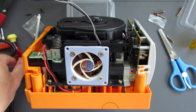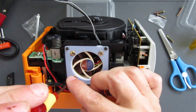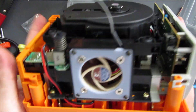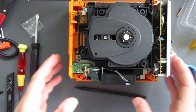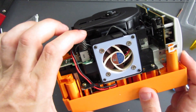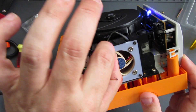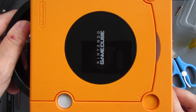This should work fine - that will sit inside the housing here, and I'll get my four little black screws that were attaching the original fan and screw those back in place. That all feels pretty solid. So that is my fan all in place. I'll feed the cable around where it's meant to go to keep it out of the way, then plug it in - and probably a good idea at this point to just give it a quick test. The fan spins up and there doesn't seem to be any parts moving or vibrating.